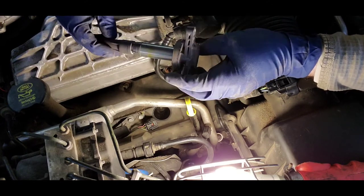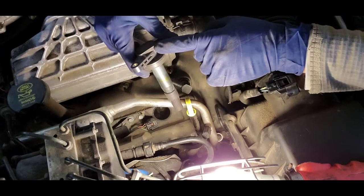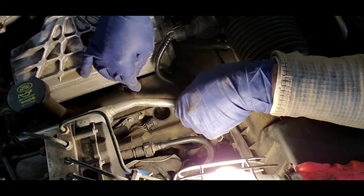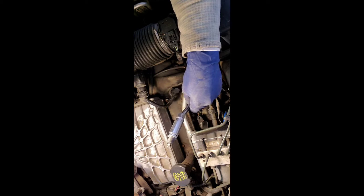This one doesn't look too bad at all. I got some factory replacement ones going in. It says 'Fomoco' on it — back when Land Rover was owned by Ford, I presume. On occasion I get P2096 and P2098 codes. With the spark plugs, it looks a little on the lean side — that's the browning — but the plugs don't look too bad, and they're cheap insurance. I don't want to tear everything apart again, so I'm replacing the ignition coils and spark plugs to be done with it for the next 100,000 miles.